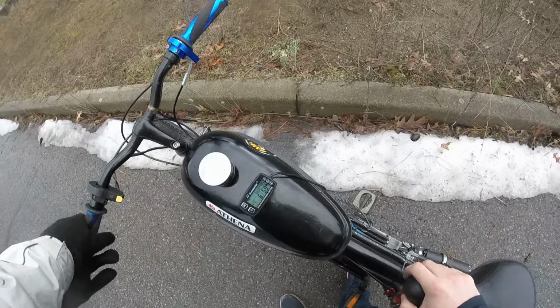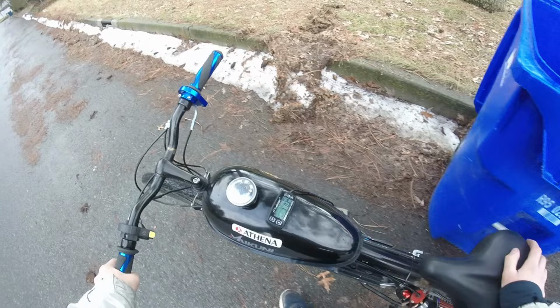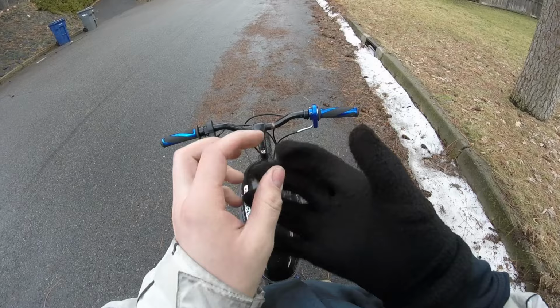What's the temp? 250 Fahrenheit. Yeah, I think I got a soft seizure, maybe cold seizure, 260 Fahrenheit. I need to tune it though, because it's running lean. Like at over half throttle, it's lean. But goddamn, 10,300. Okay, let's see if it still runs up.